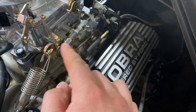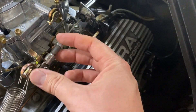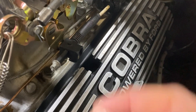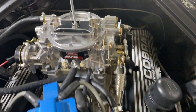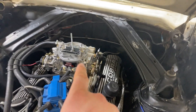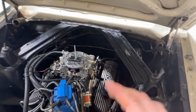Let me show you what I did just to wrap up the loose odds and ends. I had to grab a little cotter pin just to get my throttle cable hooked up. This is where I welded two nuts together and then ground down those welds — I'll probably paint that at some point. Basically the throttle cable was too short, so I did this so I could lengthen it. You can now adjust everything to get it nice and taut. I've got the TV cable hooked up with no issues, and I've got my spacers in there. You've got a few options with any carburetor on where you run your vacuum advance. I've got mine on the manifold side, so it has vacuum at all times. This thing runs great — this is why I went Edelbrock.